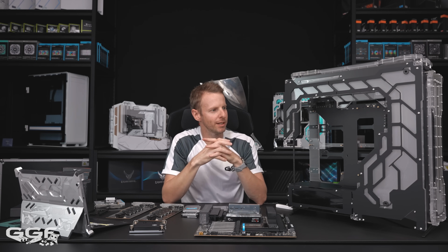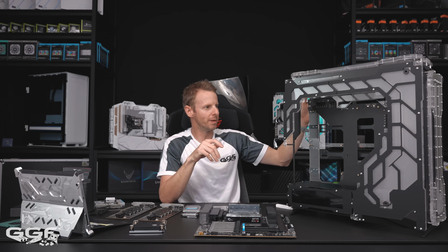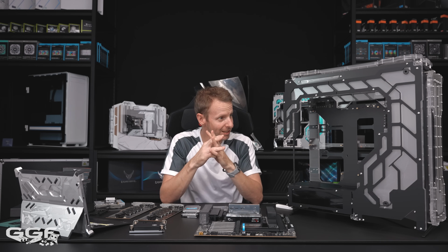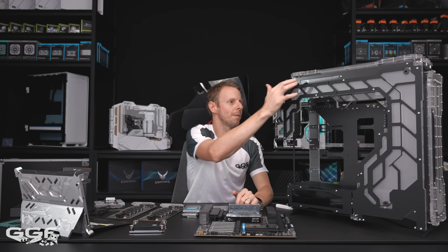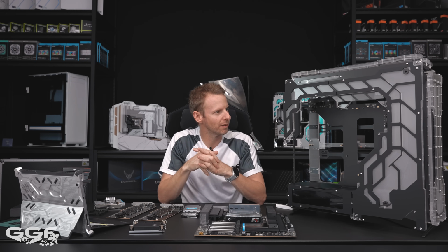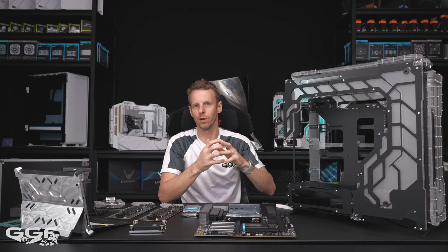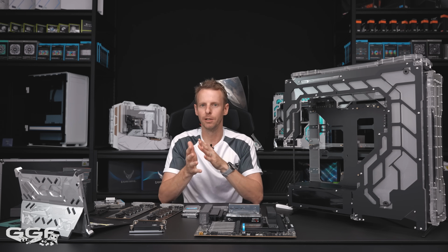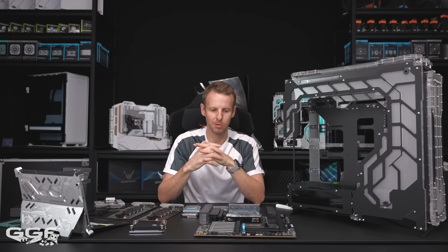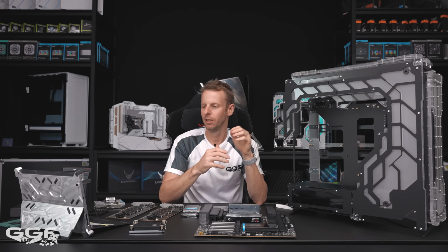The only issue I think now is you've got a heap of CPU cooling because the 3 on the back loop into the front, which does the CPU. So that's 4 360s, and then the side panel loop, which is this one, which connects to the top one, is just a single 360. Like, I will be using a 4090. These can take really thick radiators, up to 60 millimeters, so that will be fine for a 4090, but it just is a little bit unbalanced. I got four rads for CPU, and then one rad for the GPU, so I guess that's probably the only downside. I probably could try and rig it up a little bit differently, but that's not how this case is designed to go.